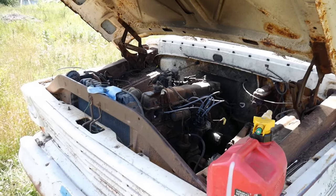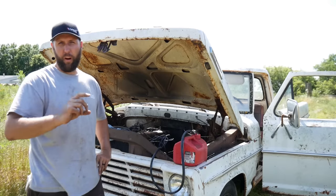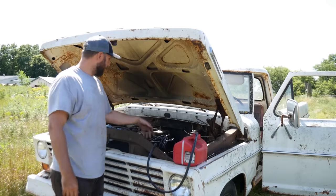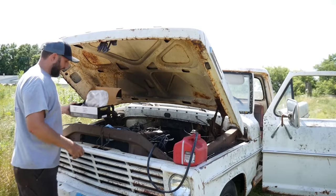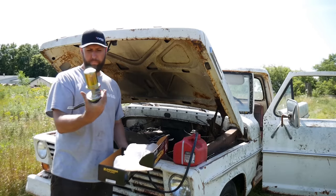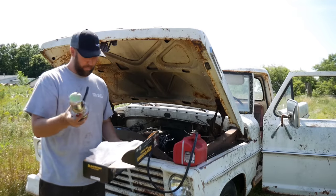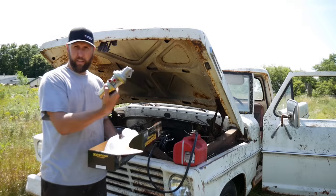Thinking the pump might be bad. Well, this is one of those many times if you just do it wrong in the first place, you'll get an answer faster. We went right to this jerry can and sure enough, she ain't pulling any fuel. I got this alien looking thing. I don't even know. I mean, again, Ford stuff, definitely not that pump. This might be to a 300 and need fittings for it.